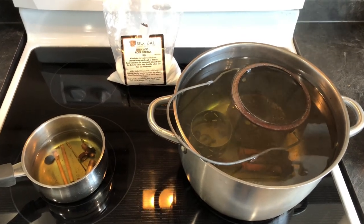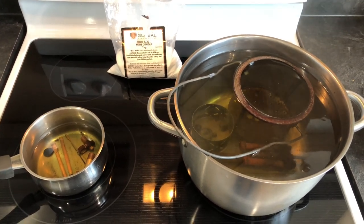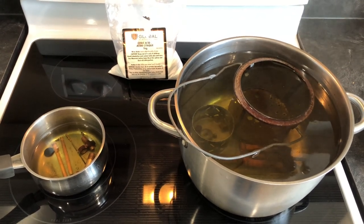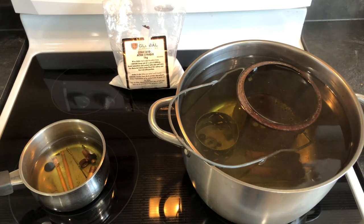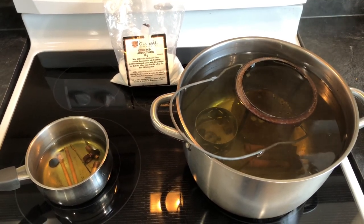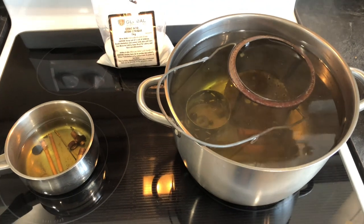We're in the kitchen now. If you've watched any of my videos, you've seen my lantern or stove soup before. This is citric acid. This removes the crud, it removes tarnish from the brass. Most of all, it removes rust from steel. And so I've got a mixture, roughly 1 teaspoon of citric acid powder to 1 liter of water. I've got brass in the small pan, and I've got steel in the large pot.